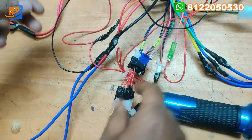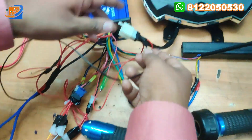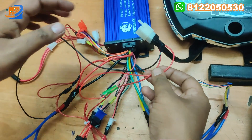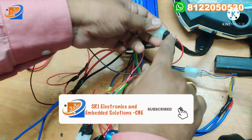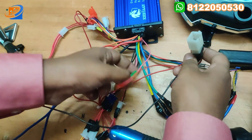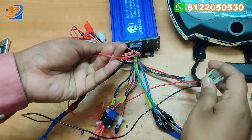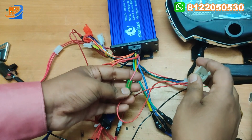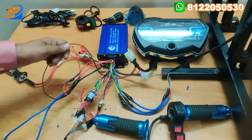That is the speciality of this three-speed connection. Next thing is the speedometer connection: the red color is the positive, the green color is the negative, and the black one is the sensor output — the speedometer sensor goes directly to the pink wire. That is all about the connections.